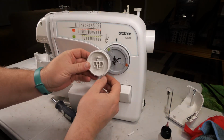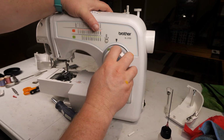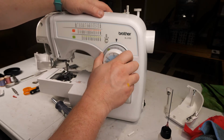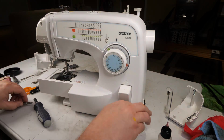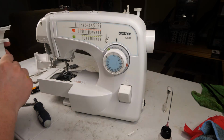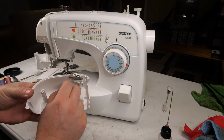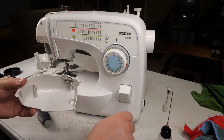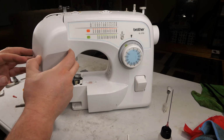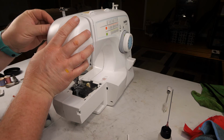Perfect. And short, tall, short, tall. There we go. These knobs appear to be in the right spot. So we can throw the cover back on. Oh, that's what this piece is. There's a pin here. This pin was glued in place here, and it just sets on a register in here to help hold this piece, which I feel like it clearly was not doing a good job of helping if it popped off like that.